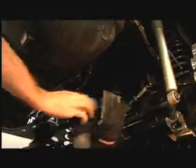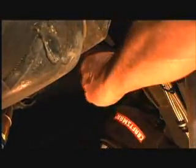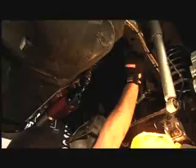You have to grind the areas clean because you're going to be welding in that area. Then we put the sway bar up in there and check it for end play. The sway bar had too much end play, being side to side clearance. The kit is supplied with shims to take up that clearance. You don't want it to be overly tight, but you don't want it to be overly loose. Then we push the sway bar up in the frame tight, tack weld it in place. Once it's tack welded, seam weld all the way around the plate.